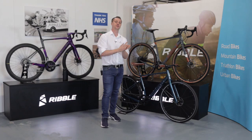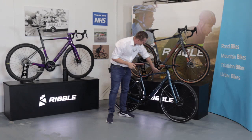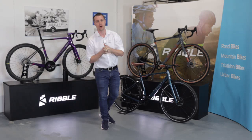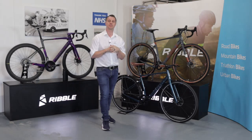So Paul is asking, is there a lifespan of the battery and is it replaceable? Most definitely the battery is replaceable. Of course it is. It lives in the down tube, like we said, and it is placed into the bike through an access hatch right at the bottom of the BB, held together with those three lugs. As with all batteries, there is a lifespan, which is about 550 life cycles from 0% to 100% charge. E-bike motion also issues a notification not to deplete the battery to 0%, but to always keep a charge of at least 10% in the battery.